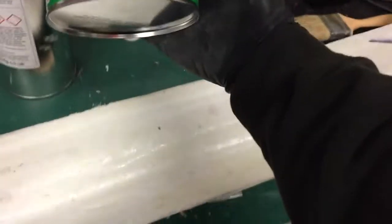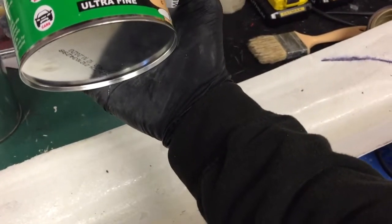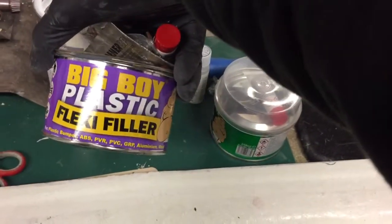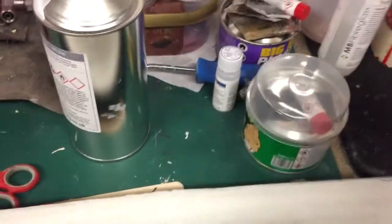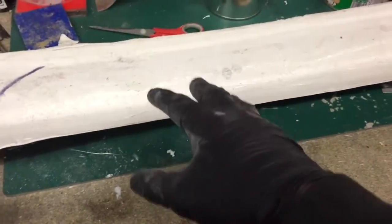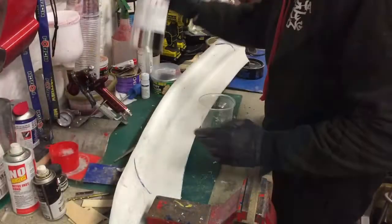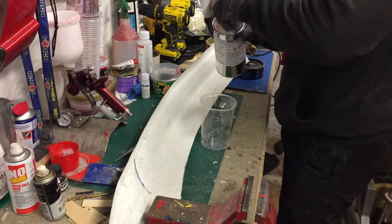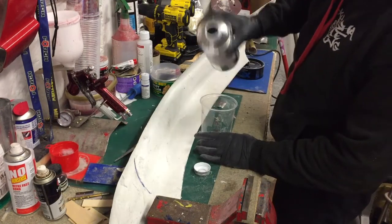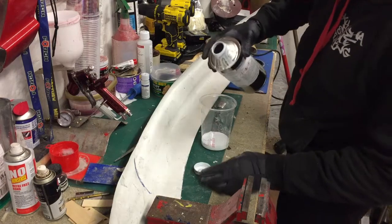The new filler's arrived — I've got the actual normal body filler, the easy sanding body filler this time. It was about £6.50 I think, and I did read online you can actually use this on fiberglass, so it should be okay. I've used it quite a bit on the actual front already. What I'll do now is cut up some fiberglass, mix up some gel, and just lay that in there. I'll stick you on the tripod so you can have a look as I'm doing it — some people might find it interesting, some might find it boring. It's pretty cold today so I'll do a fast mix with a little bit more activator.